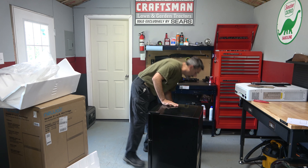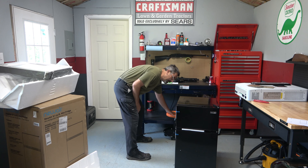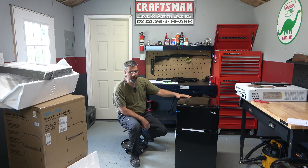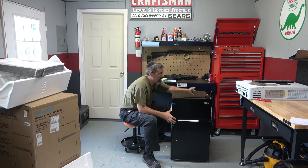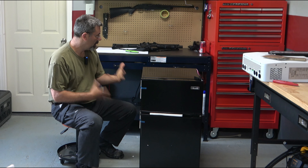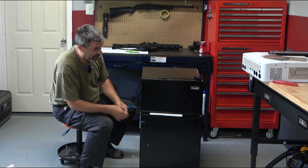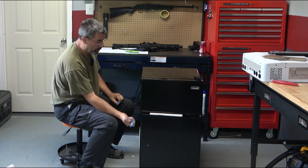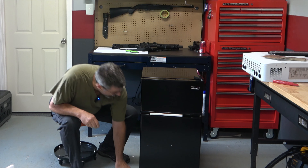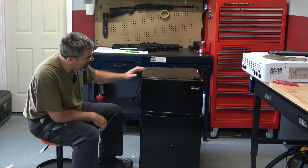Now it's important to note while I get this out of here: if you're going to get one of these and it's been shipped like this one was, or if you pick one up at the store and bring it home, remember that if it's been tilted on its side or laid on its back or anything like that, give it about 24 hours to re-acclimate. All the gas needs to be in the gas section and the liquid needs to be in the liquid section. If you rush it and those aren't where they're supposed to be, you can damage the compressor pretty quickly. This one has been sitting overnight — I got it home yesterday and I resisted the temptation to plug it in.